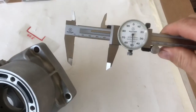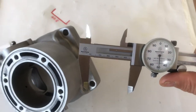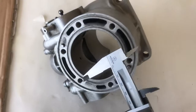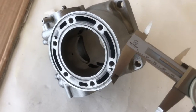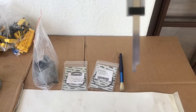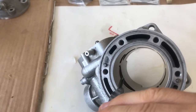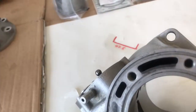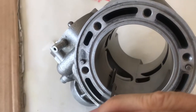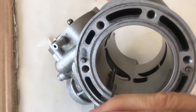First way — I have my trusty calipers. I've set that to 47.5. Now I can't put my calipers down there directly because it's going to scratch the bore and you can't quite get it in there. The great thing about these calipers is that they've got a depth gauge. So with the depth gauge, we can very gently rest the caliper level on the top of the cylinder, and the depth gauge goes down to the power valve. We'll be at 47.5. The best way to look at that is to look up the exhaust port.